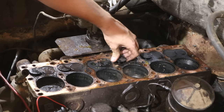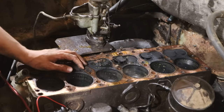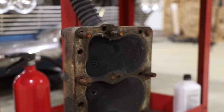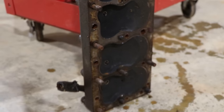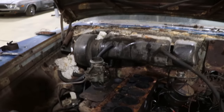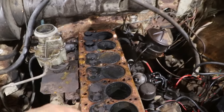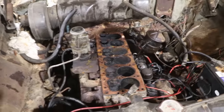I don't see any stuck valves, don't see anything binding up. Looks like everything is doing what it needs to do. I just think it's worn out. There's a serious ring ridge on this one and a lot of carbon buildup. The valve guides could be loose, but they don't seem to spin. The head gasket doesn't look like it's broken - it's an old copper one, that sucker's stout. I really just think it's worn out. It would really need a good rebuild. You could hone the cylinders and re-ring it, but it's pretty far out of spec - you might do all that work and it would still be bad.